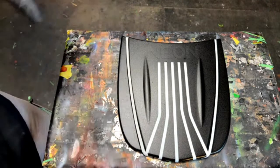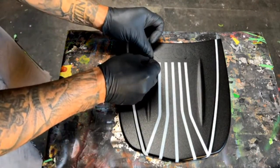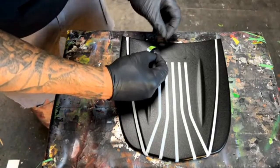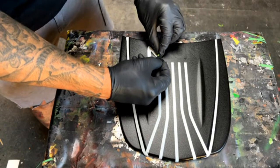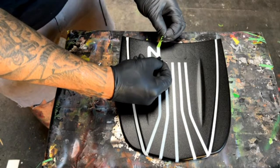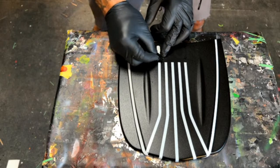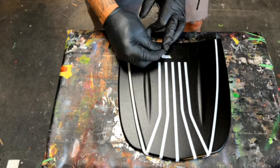You'll be able to get set up with those primary colors, which will let you do almost any color. You mix your orange, you can mix your purple, different shades by doing different mixtures. You can mix your root beer browns. I'll have the black candy. We'll have the base coat, clear base coat, like we talked about. And we'll have reducers, and we will also have gun cleaners, like a lacquer thinner.